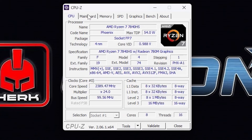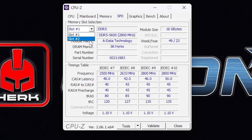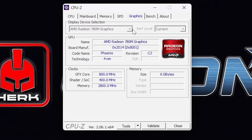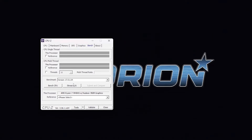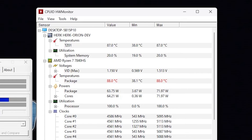The CPU is an AMD Ryzen 7840HS — it was a bit confusing because I thought the box said Ryzen 9 — with a max TDP of 54 watts, so it's a mobile chip. It features the AMD Radeon 780M integrated graphics. The memory is DDR5 with two slots. During a stress test today, which is quite a hot day, temperatures are hitting 88 degrees Celsius and the fan is spinning up noticeably.